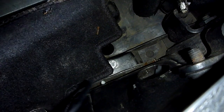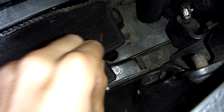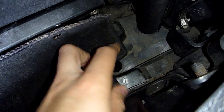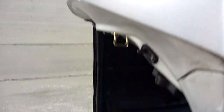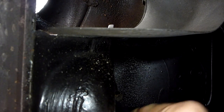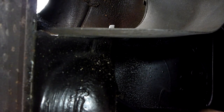Essentially, what you do is you take the cable end and you feed it down into the hole, and you keep going until you reach the flap. You'll notice when it gives a bit of resistance that you've got to the flap. And then you need to kind of work it past the flap — it can be a bit difficult, but you'll get through eventually. And then what will happen is it will pop out the bottom of the car. Then you get under the car and you pull from the other end, and give it a sort of pulling and pushing motion, just to allow this brush thing to scrape up and down the tube and remove any dirt and debris.